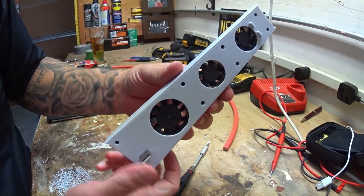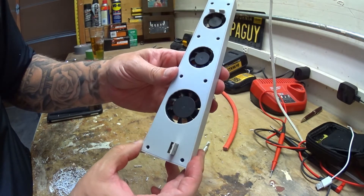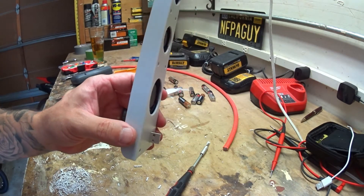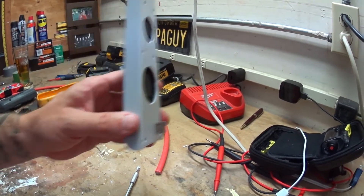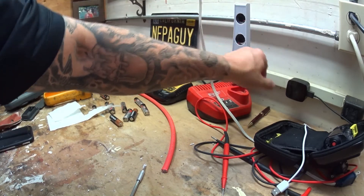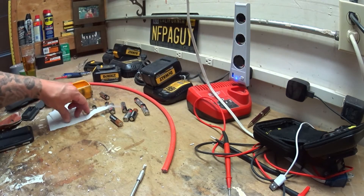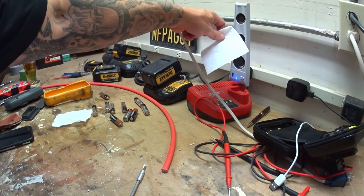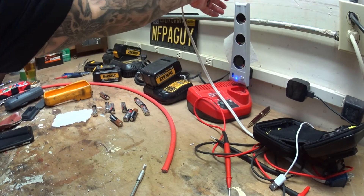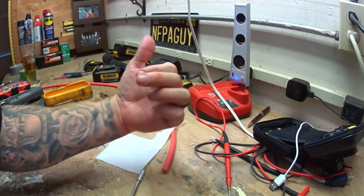Here's the end result. The unit is all reassembled. The eight screws are back in. The USB ports are looking good. The fans should now be reversed. We're going to plug this into our outlet and see if we have better airflow from the original test. Remember that the PlayStation will be against the wall here, and I can already feel a major difference in air movement — it is in fact blowing towards my hand. You can see the difference in airflow; even up top, it's blowing the tissue further back than it was originally. On the intake side it sucks to it — so that's what you want. You want this thing blowing, or sucking air, out this direction from the back of the PlayStation 5.